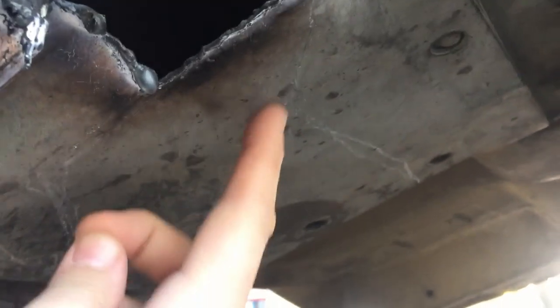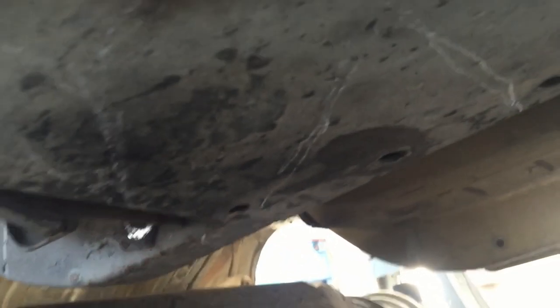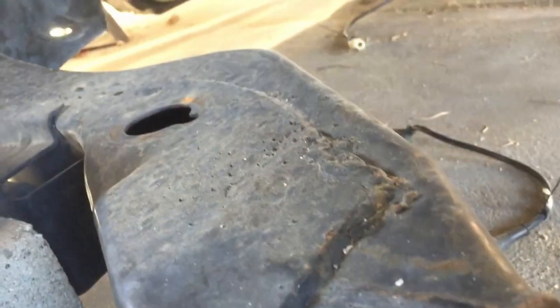You can see the frame goes straight and then it kicks out over here, and then that needs to be cut into this back torque box. I kind of had some reference lines in the past of where I was going to cut, and this is where the rear subframe comes back in — a lot of that's going to need to be notched with what's going on back here. This is where the plumb bob can come in handy — I'll be able to reference points at the top and then have it come down to the frame.